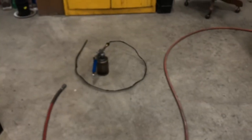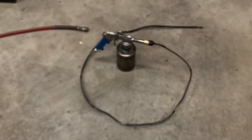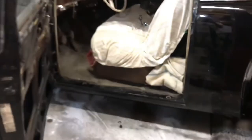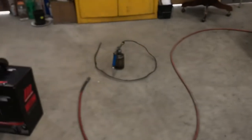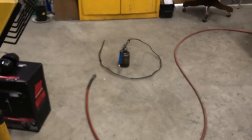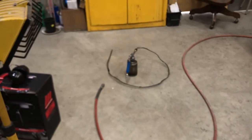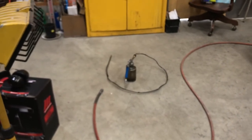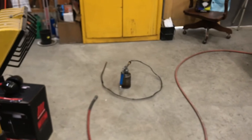Anyways, I just like to make my own stuff, and I think this is going to work really good. I hope this helps somebody — at least you know the cavity sprayer setup. You can buy these online and they're not that expensive. Now that I've sprayed wax with this thing, that's what it's going to be dedicated to. I did some cavity spraying on this car with paint on the right side rocker, so I won't be able to do that anymore unless I completely clean it out. It's a wax sprayer now, and I'll have to take a heat gun to it before I can use it again because the wax will plug it up. Even at the end there it was getting a little spotty — it would spray wax and then stop, kind of pulsing. You could hear when it was spraying; it got kind of wet-sounding.